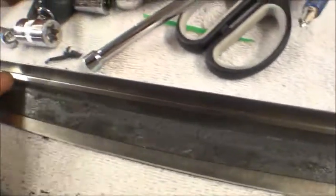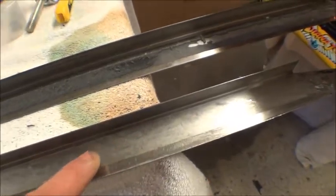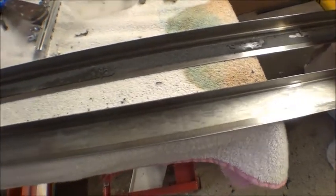So when you strip them off, there's all this foam rubber stuck on behind. So before you stick these back on, you need to give them a real good scrape with a heavy scraper. You can get most of it off like that. And then if you clean it up with white spirit afterwards, it makes all the glue go soft, and you can give it another scrape with a scraper like that, and it'll get most of it off.